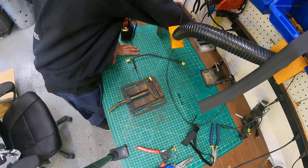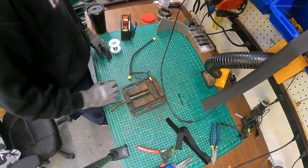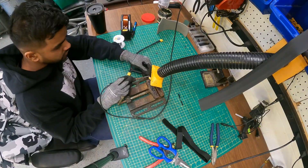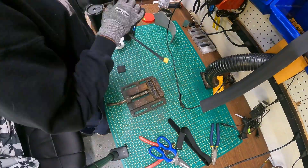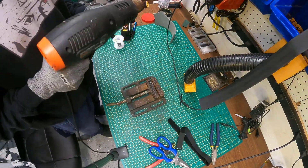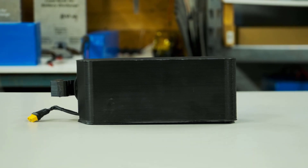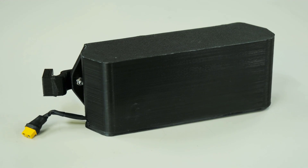Here is the ASI BAC 855 controller. We made the harness for this using the L1019 connector for the motor. Simil is making the series connection for both batteries — you take the negative from one battery and the positive from the other and plug them into the controller, then bridge the other two wires together so the positive of one battery feeds into the negative of the next battery. That's how you do a series connection.